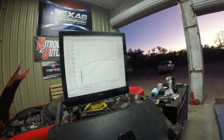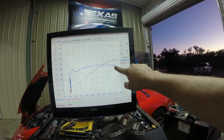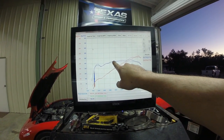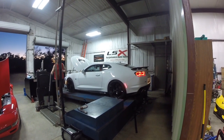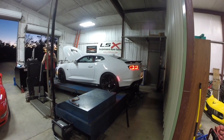Headphone users beware. You can see the graph is a little different with the valves open — pulling farther up in the RPM range, though around 6400 the throttle started closing again. We might see a little more power. The torque curve is a little lower, probably due to less back pressure, but the horsepower is definitely there — it made almost 15 to nearly 20 horsepower more on that pull. We're going to adjust it a little more and do a final run to hopefully correct the throttle body closing at 6400 RPM.